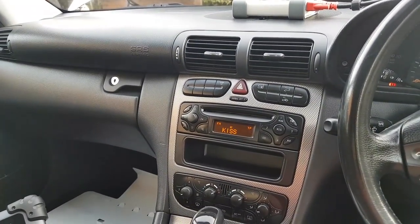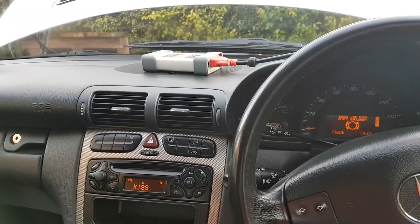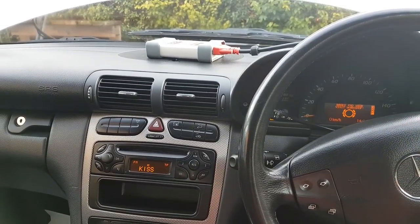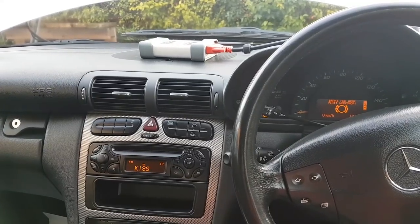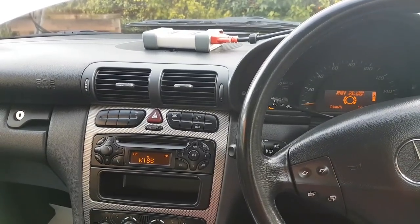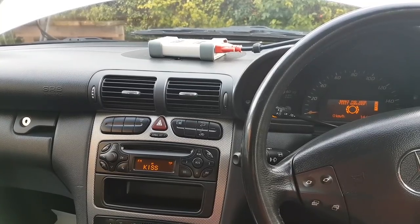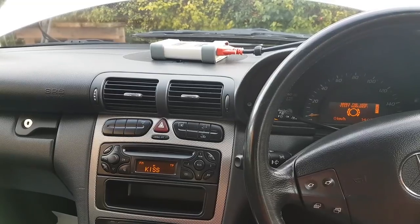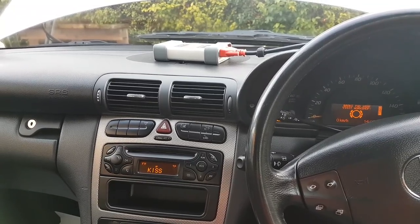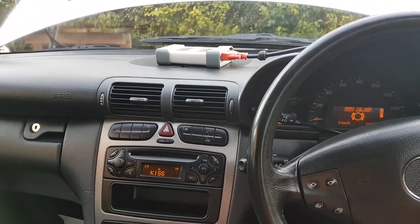Quick inspection done - we can't see anything wrong with it. It was plugged in correctly, no corrosion, everything looks tight and clean. But there is one thing - the air flow meter on this car is not a genuine unit, it's an aftermarket one. I don't like aftermarket air flow meters; I've had very bad experiences where the ECU just doesn't like them. Nevertheless, I'll connect the Star machine and see exactly what readings are coming from that air flow meter.